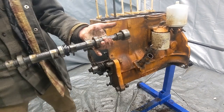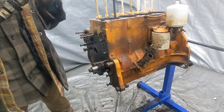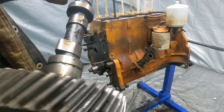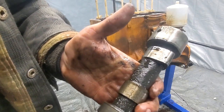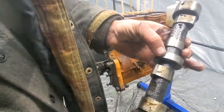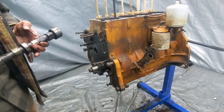Okay, camshaft - sweet! Initial visual inspection, this all looks really good. I don't see really any signs of damage there. We'll have to measure these bushings and stuff, make sure that they're good - or rather, these are the journals, so we'll measure the bushings as well and pull them out if we have to.